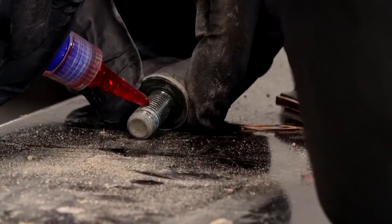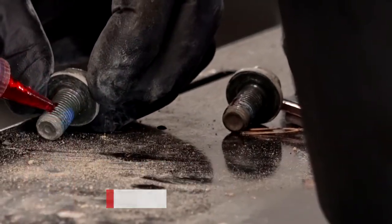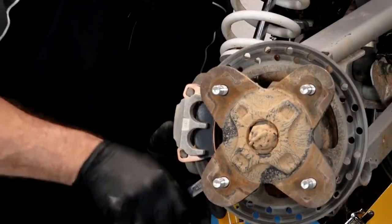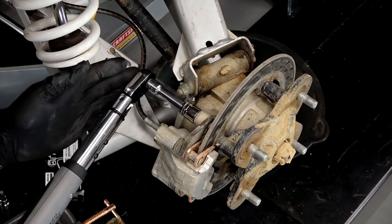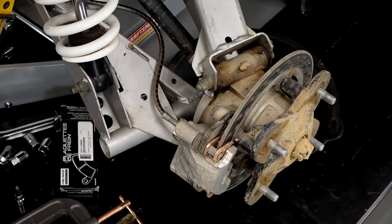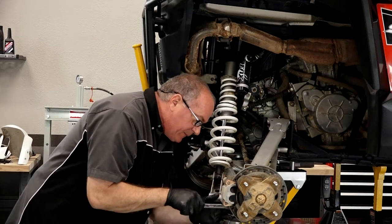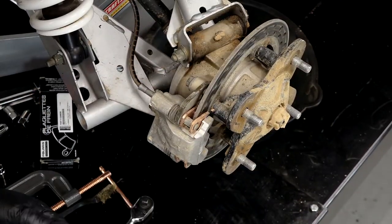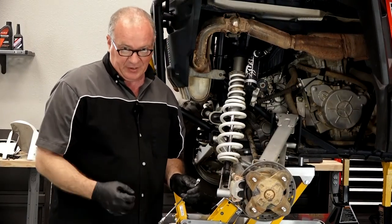When we put the bolts on, I like using just a little bit of Loctite to hold these in place. They actually use blue from the factory, but I'm using just a little dab of the red. Let's get these snugged down. These are supposed to be torqued to 46 foot-pounds, and it's no problem getting to the one up top, but the one at the bottom's the issue — you can't get a torque wrench in there. So hopefully you felt how much pressure that took, because I'm just going to have to estimate it with a regular old box-end wrench. I'm sure they make offset adapters where you could get one in there, but I don't have one handy, so I'll just have to trust that I put enough on there and the Loctite will hold it in place.